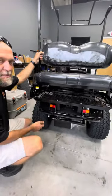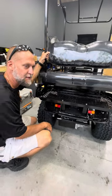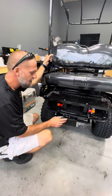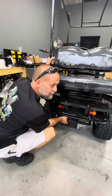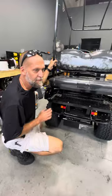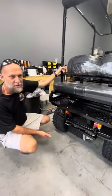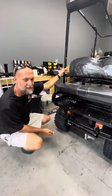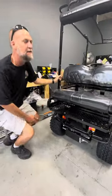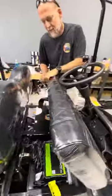Make sure that you engage it — you'll hear it click, and now it's locked. It needs to be engaged all the time when you're in forward or reverse mode; otherwise it will roll down a hill. However, if you push it too far it will stick and be free-rolling. Take two fingers and pull it out just a hair until you hear that click — when you hear that click it means it's locked and engaged.